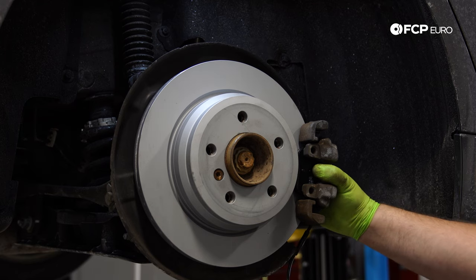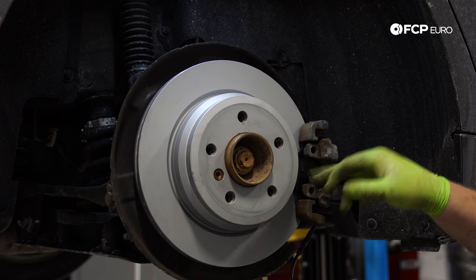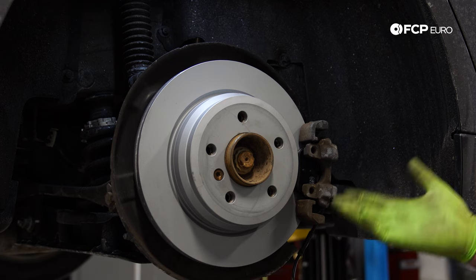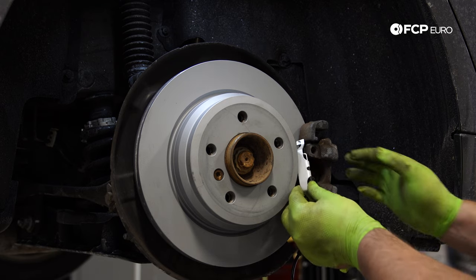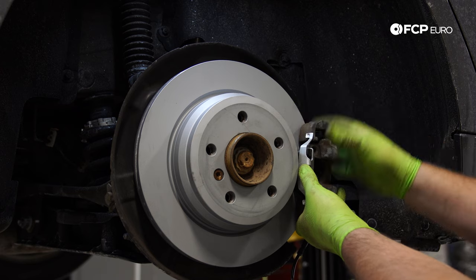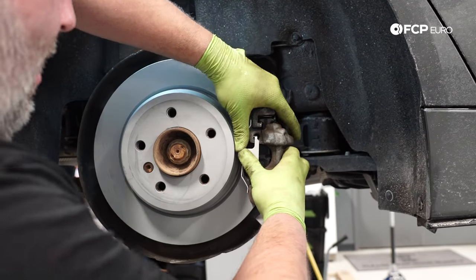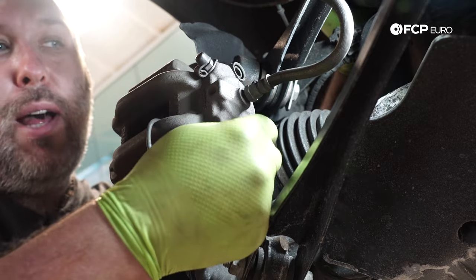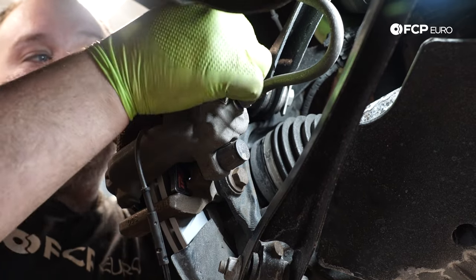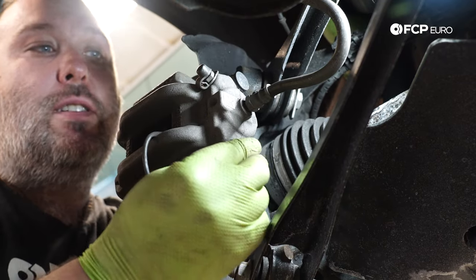Here's a good illustration of what the anti-rattle clip does: without any tension on the caliper and the carrier, the pad can just sort of slap around inside of there. So the anti-rattle clips do exactly that — they prevent the outboard brake pad from making a rattling noise. To reinstall, make sure that the ears of the spring are sitting on the carrier, and then use your thumbs and push in. Now we have the anti-rattle clip on. We'll put our guide pin covers back on — they just clip into place. If your vehicle is missing these, highly recommend that you replace them. Just make sure that they're seated fully.